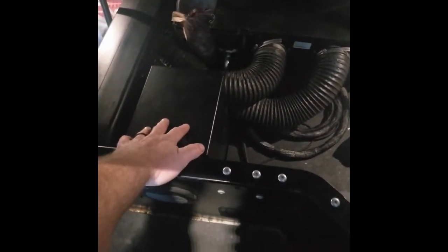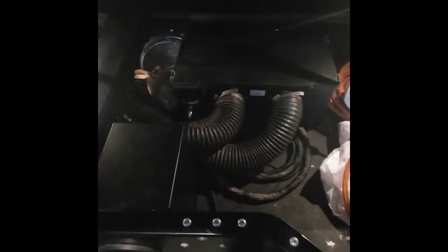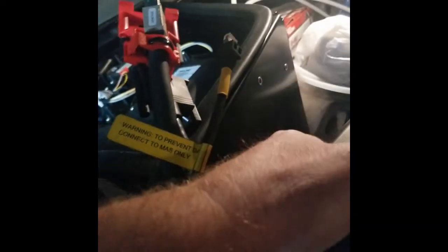You can see here's the S-bar vent where the heat comes out. This cover is covering it up — this is the first thing that's going to have to come off. Actually, this air exchange pipe hooked to these two hoses has to come off first just to get it out of the way. So I just lift it up. There's some wires over here for the electrical, so just be careful of these. This just pops straight up.